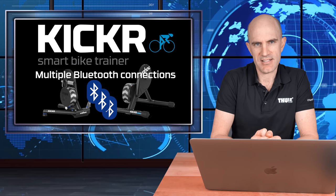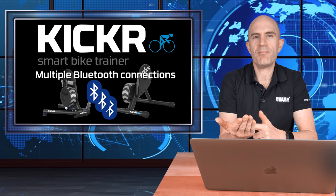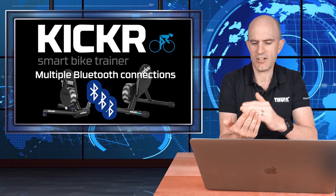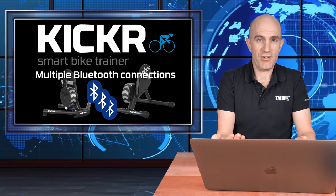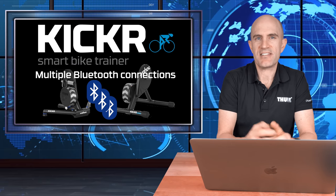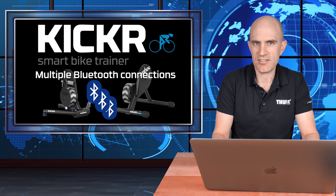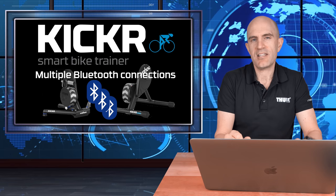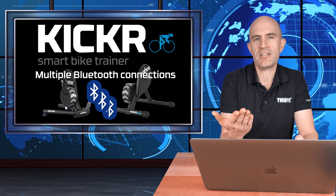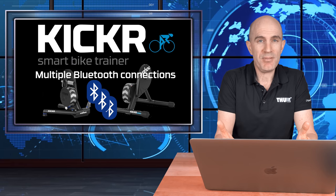It does, until it doesn't. You may have encountered a situation where you loaded up Zwift, Rouvy, TrainerRoad, or Sufferfest and tried to connect to your trainer over Bluetooth, but just can't see it on the list. The technical solution is to turn it off and back on again — and it appears. What's probably happened is that something has grabbed hold of that Bluetooth connection, taken it out of advertisement mode, and ghosted the device so nothing else can see it. Turning it off and on resets that.